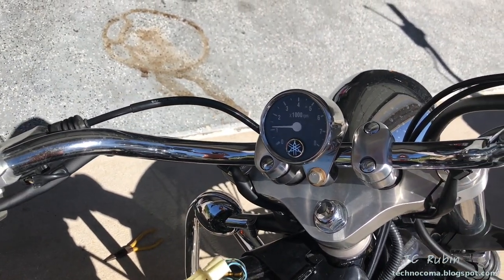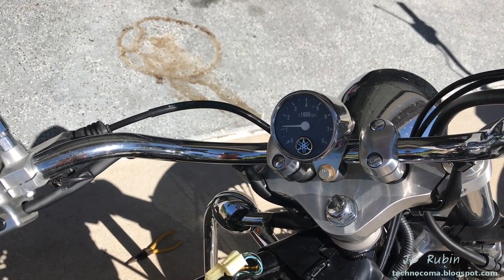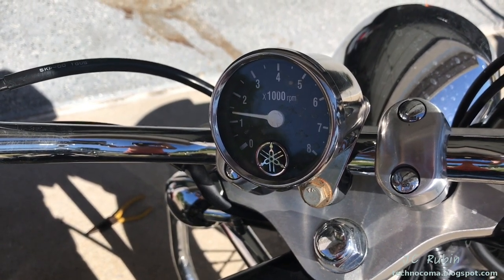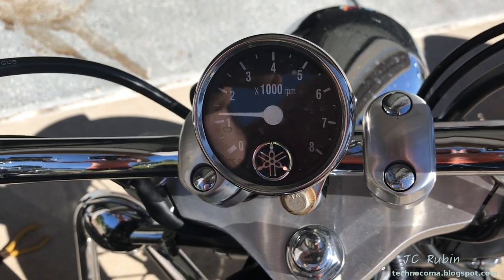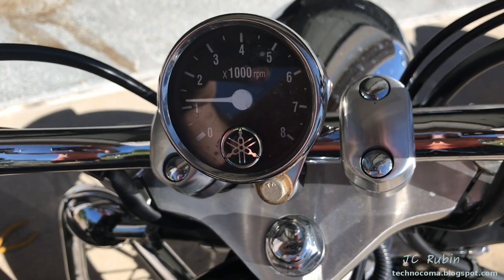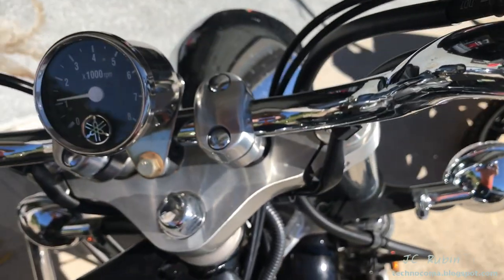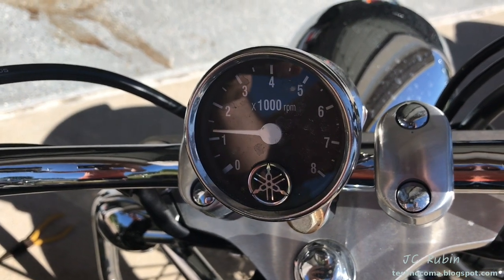What I'm most concerned about is the just-off-idle operation, as before. So I'm going to very carefully roll off idle — right there. That's what I'm looking at. I'm going so slow — watch my hands. When you can go just off idle like that, the problem's been solved. Then you've fixed it.